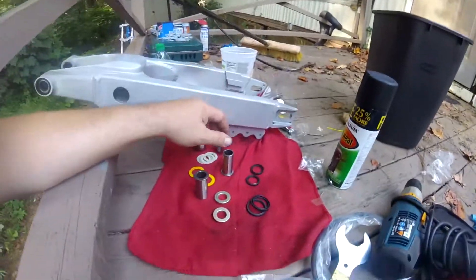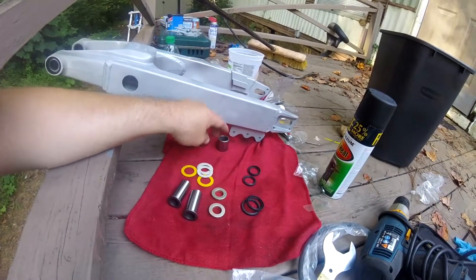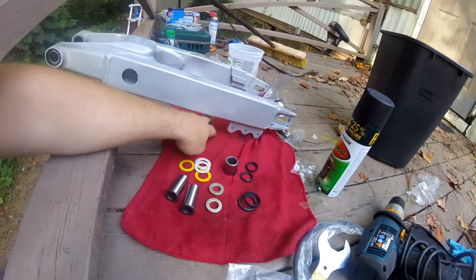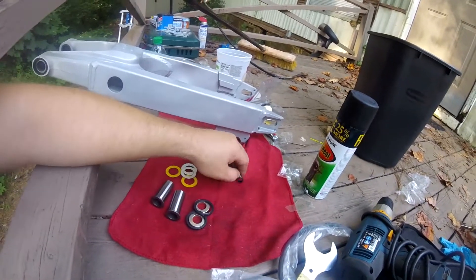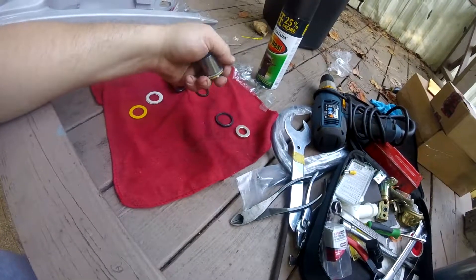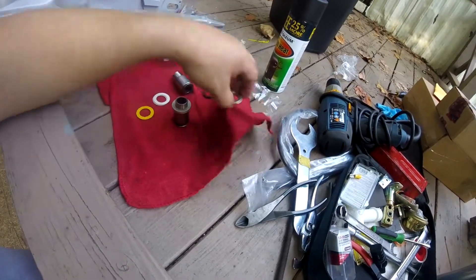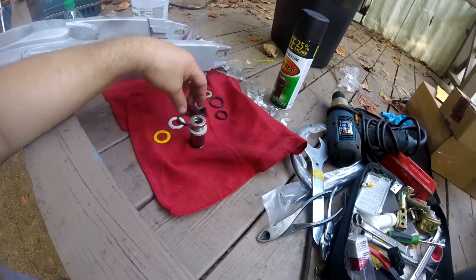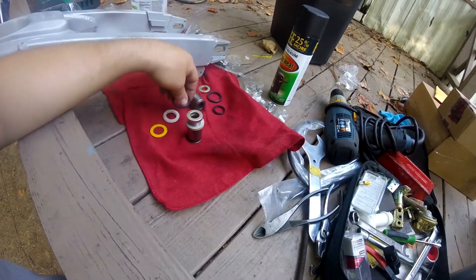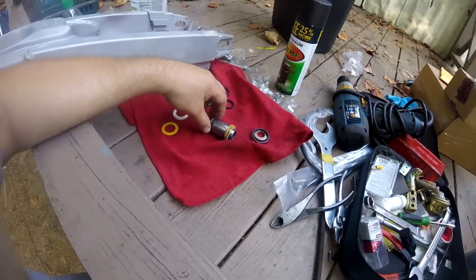Let's look at how these swing arm bearings are going to go. Collars, thrust bearings, side load bearings. The main bearings themselves. The collars go outside and the seals. These are the inside seals. It's hard doing all this one handed. A spacer here. That spacer is too small inner diameter to go there, which is right, so that way that seals up on the outside. So that's how the bearing is going to look.